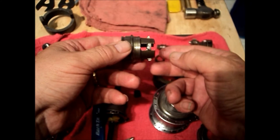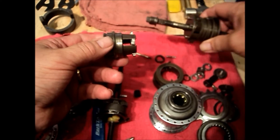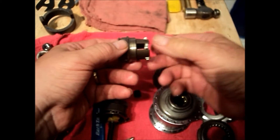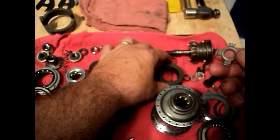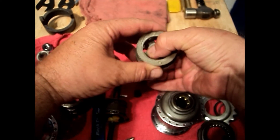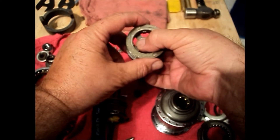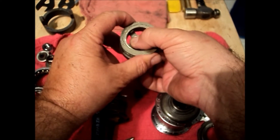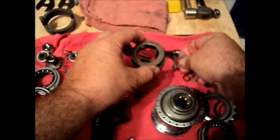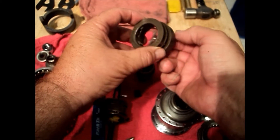the middle position is second gear, and in third gear the star clutch engages the pins on the planet carrier. In the first two gears the star clutch drives the ring gear. Between the point where it leaves engagement of the ring gear and engages the planet pins, there is a very narrow window where there is no power transmitted.